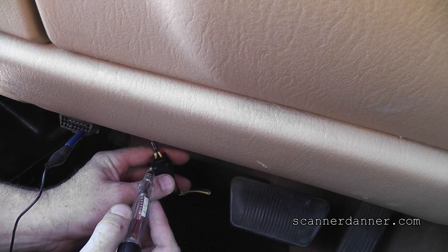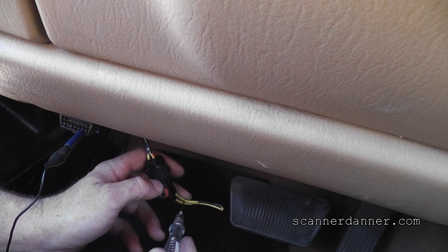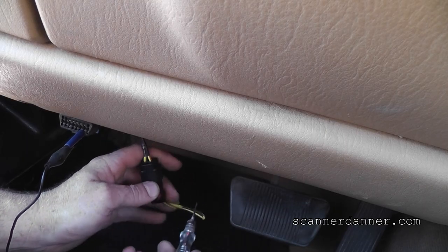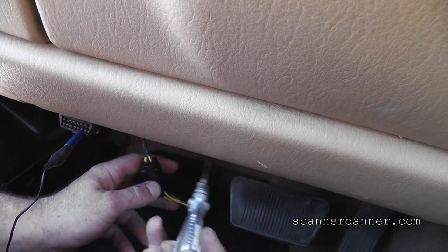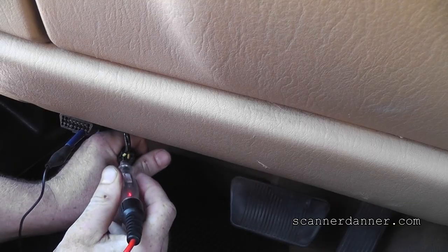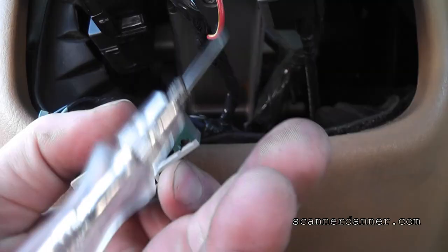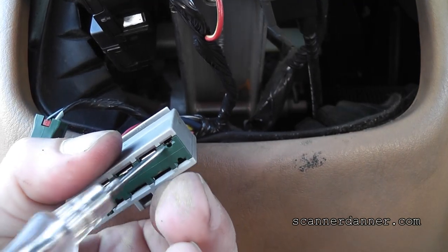Just so you guys are clear: this wire here comes from the ignition switch, it loops through and turns into yellow-red. This loop is here for a manual transmission — there are differences. Yellow-red then goes to the starter relay control side. They made this wire pretty fat even though there's only about 100 milliamps on here, and that's why I can make it start with my incandescent test light. Our concern is from the ignition switch down to here, because I can make it go from here. Now back up to here — I cannot make that crank. So I have an open in between the two.